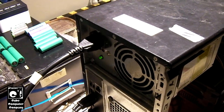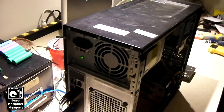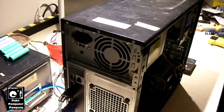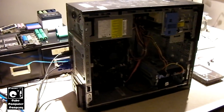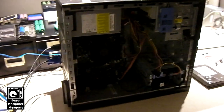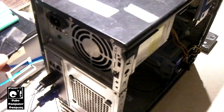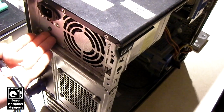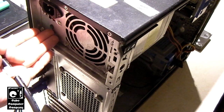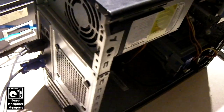You can see how power good started right up that time. I'll let it sit and get video footage of starting it from cold next time. I've let this thing sit for a little bit — let's go ahead and plug it in and see what it does. Being the OptiPlex 390, it's going to automatically do a self-test and turn itself on. The power good LED should come right back on if it's working properly — if there's any delay or it flickers on and off or stays out, then we know the power good is not properly functioning.